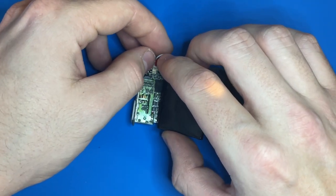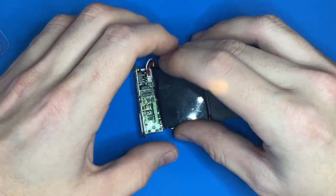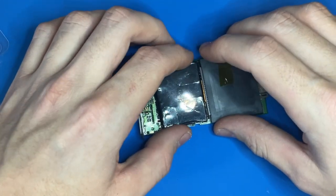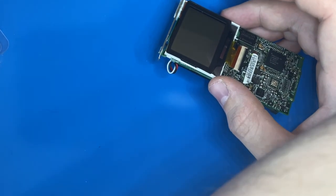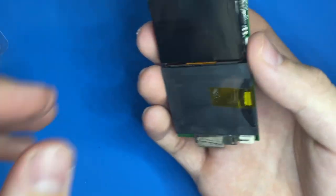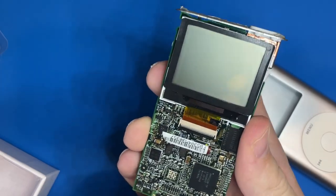Battery goes between the headphone jack and the drive — it can be a little difficult to place, it's a very tight fit. I also put a small piece of alien tape — a tacky double-sided tape, it's like a thick gel — on the back of the batteries. You always want to be really careful when reassembling the mini because you don't want to short it out. Before I do that, I'll just reconfirm one final time that I have a folder icon. Okay cool — and now it's stuck. That was a bad idea.